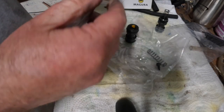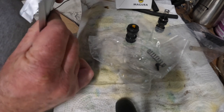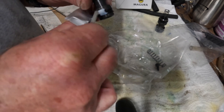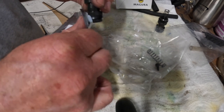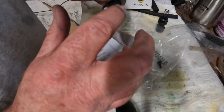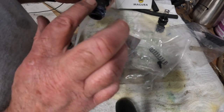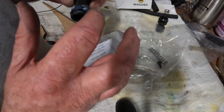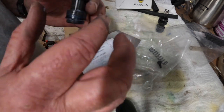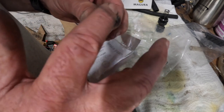I'm not going to use brake fluid to lubricate the seals — it comes with a brake paste. On the primary seal at the back, you put a lot of lube on it. I'm guessing that's so the seal doesn't fold over as you put it in. Then on the front seal, it says to lightly lubricate it, so we're just going to use a little bit of this extra off the edge and lightly lubricate the front seal.